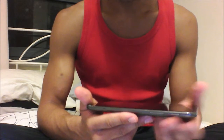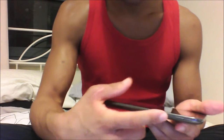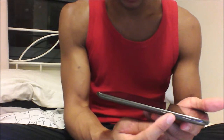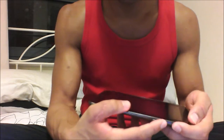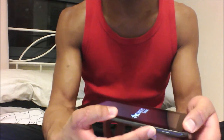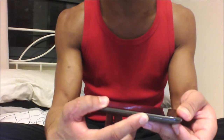What you want to do first is hold the power button and the volume up button. This is the power button here and this is the volume button, so you're going to press the top part of it. Do that now and wait for the Samsung logo to appear. Once it does, let go of the power button but keep your finger on the volume up button.